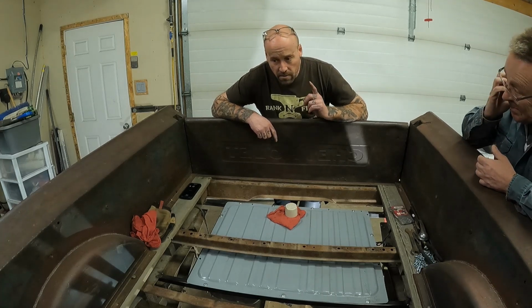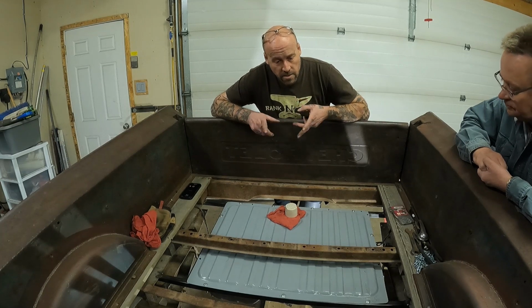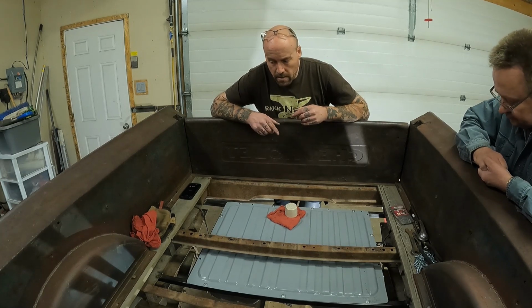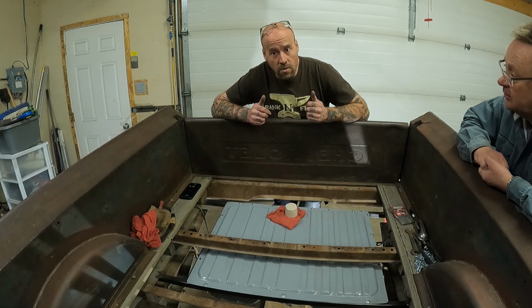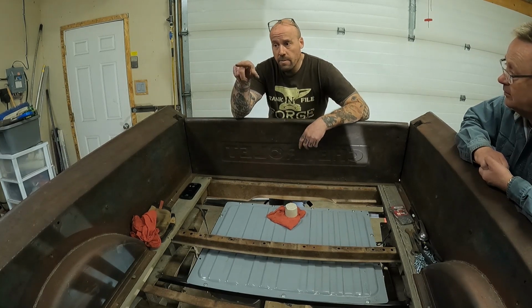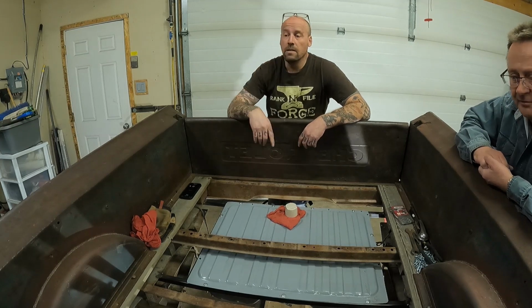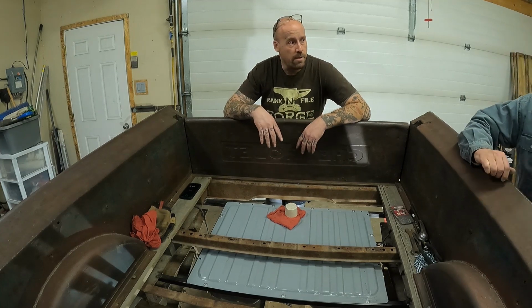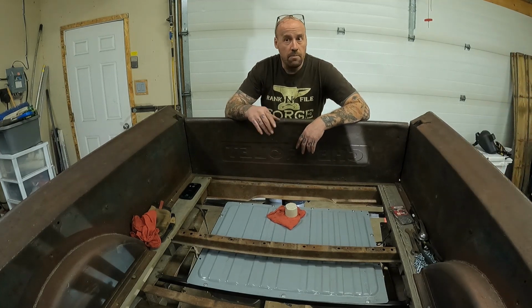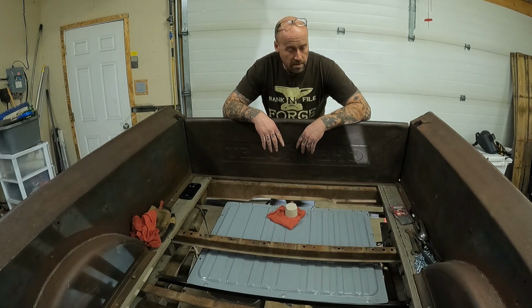Sending switch is on. I got to get the fuel line. I extend the wiring on it. I should have everything I need for the wiring. Then I got to drain the gas tank, get the old gas tank out. Then I got a patch panel for where that gas fuel filler is. So I'm going to remove that, tack in a panel. I can weld it up. Should be pretty good. And then I'll put some brown, red primer on it to kind of blend it in a bit. Don't want to take away from the patina too much.